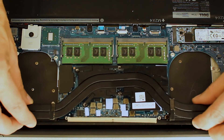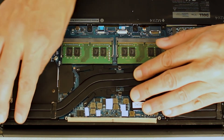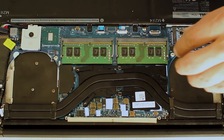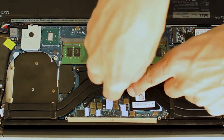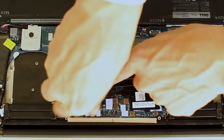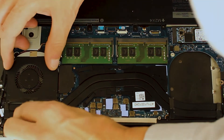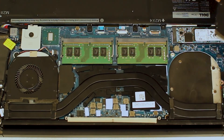Now to place the heat sink and the cooling fans back in place, reconnect them to the main board, and reconnect the battery. Don't be tempted to lift the heat sink at this point — you will only cause air bubbles within the thermal paste, decreasing its efficiency. After completing this procedure the laptop managed to reduce video rendering times by nearly 50%, and the newly installed thermal pads and thermal paste are also helping to keep laptop temperatures far lower, so processing speeds remain higher.